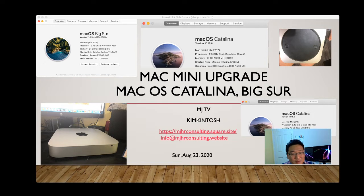As you can see, this is a Mac keyboard with the Option key. Hold the Option key when starting up your Mac Mini and you'll see both the Windows disk and the macOS Catalina disk — choose which to boot. Alternatively, go to Apple menu > System Preferences > Startup Disk, select Windows, and you can start Windows right away.